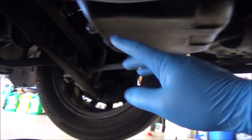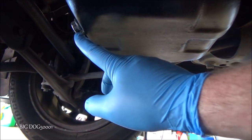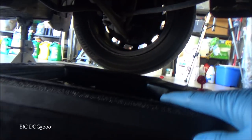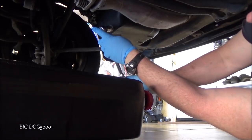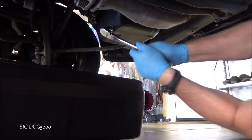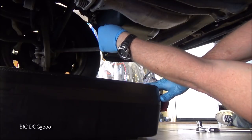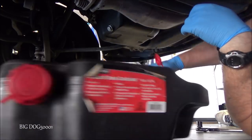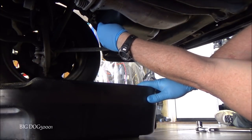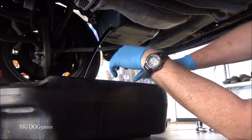Looking under the bottom of the car, from our jack point right here, there's the bolt and there's your oil pan. We're just going to pop that 17-millimeter loose, let it drain right into our pan — position it so we don't get oil everywhere. As long as somebody didn't put it on too tight... yeah, that was on there right where it should be — I think because I'm the last one who did this oil change.